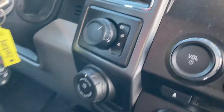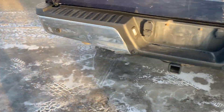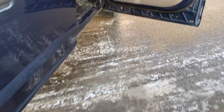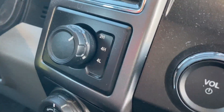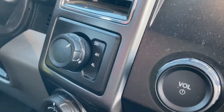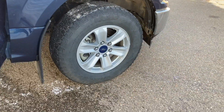So to make this work, we had to literally put our foot on the brake, then pull on this. Now take a look — that wheel's spinning, this wheel is spinning. You've heard me talk about the G80, but this is another huge deal. You notice this only has two high, four high, and four low. Every single 2019 and newer GMC pickup truck that's a 4x4 gives you auto 4x4, which means now the front wheels would be driving wheels and drive this vehicle backwards, because right now they have traction.